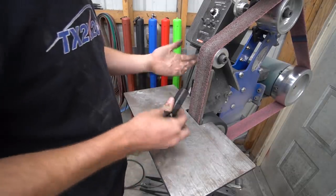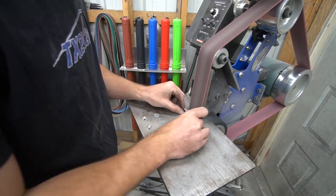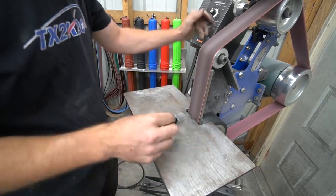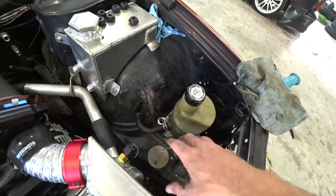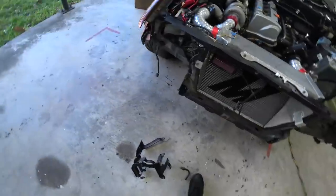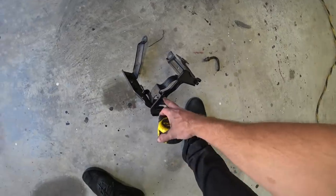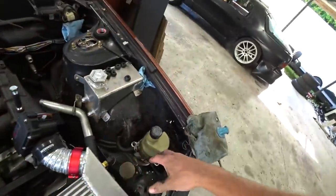The measurement we need is about two and a half inches to get this just off the bottom so it'll be isolated. I was just staring at this bracket and realized — what do you know — two and a half inches, it's literally perfect. I'm going to unbolt this part of the bracket from this part and see if we can make that work. That way it all bolts in instead of welding, so we can change it later if needed.